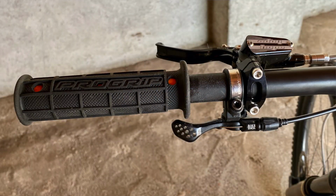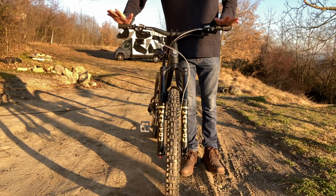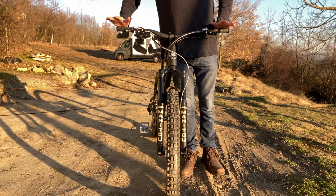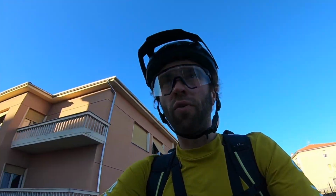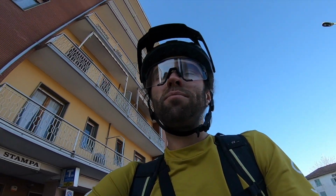We've got the Pro Grip push-on grips, which are nice and soft, and the fork has got really, really low friction thanks to all the RRT treatment that's been done to it. Obviously, turning up the compression damping can increase the harshness coming into your hands. So if you can reduce the forces, vibration, impact coming into your body through the grips, handlebars, tyres, wheels, friction in the suspension fork, then you can have more damping, which is what you want, to have more support without getting more harshness coming into your arms or hands. Same on the rear.